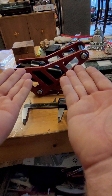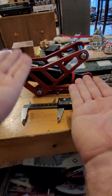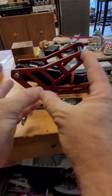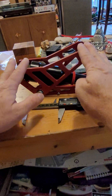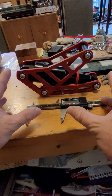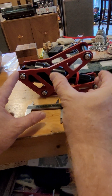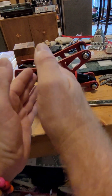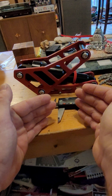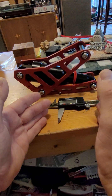Remember that most mountain bike calculators take into consideration that the weight of the wheel and rider is distributed between the front and rear wheel — we don't have that liberty on a unicycle; all the weight is on the back wheel. So the ratios and calculator numbers are going to be a little bit different. But if the stock linkage requires a 2,400 pound-inch spring ratio with 21 millimeters of travel, and you change that to 50 millimeters, you now require only a 400 pound-per-inch spring. All of a sudden we go from outrageous, completely unreasonable ratios to very reasonable — a 400 pound-inch spring ratio is well within the scope of normal.